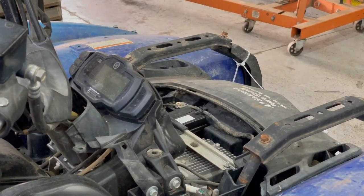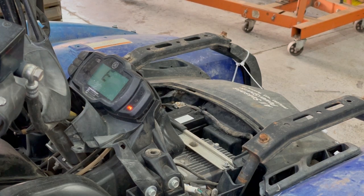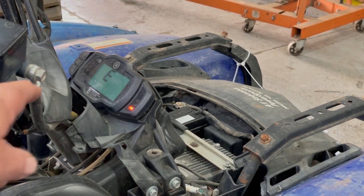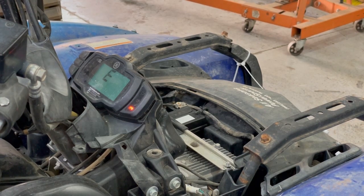I'm gonna turn the key switch on here. You can hear the fuel pump kick and everything, but when you push the starter button it kicks over but won't start. And on the video dash there it's blinking an E. I called a Yamaha Tech and having an E on there is not good. So we're gonna do some testing and see if that ECU is bad or not.